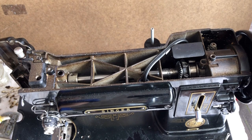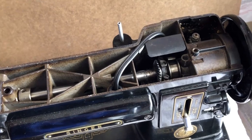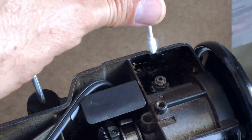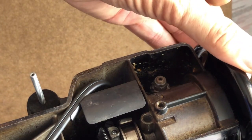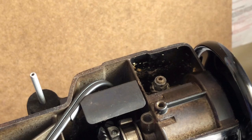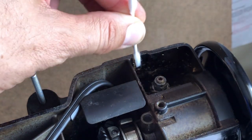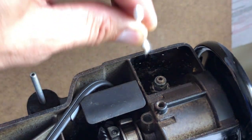One thing to mention when you're going inside: this place on the upper right is the little compartment where the worm gear of that direct drive motor lives, right there. It's lined up with the textile-like gear that you saw me put grease on. Sometimes with a machine you will see old grease that splattered, and you can see I could pull it off with a cotton swab.